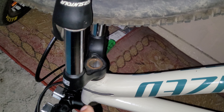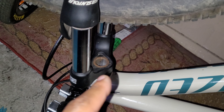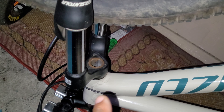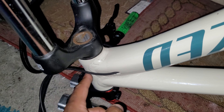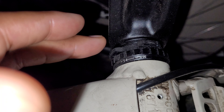The next topic is this: because this is a 1-1/8-inch headset — what we know as 1.125 or 1-1/8th — this bike is not tapered. It's not tapered at all. So you must understand: 1-1/8th top and bottom, this uses a straight steerer, not tapered. This takes the ZS44 headset, what means zero-stack 44, 1-1/8th, straight steerer, no taper.